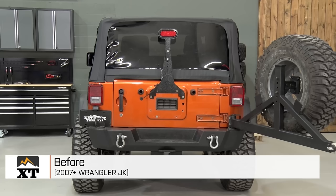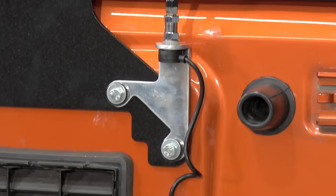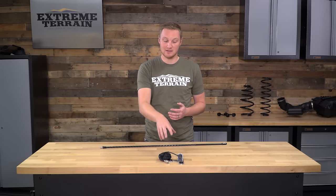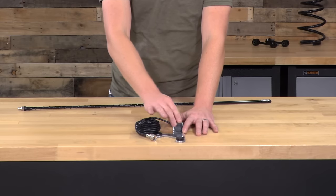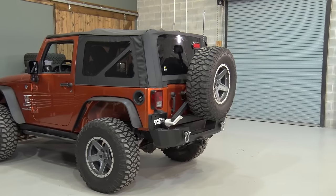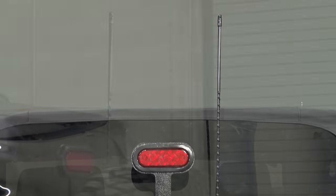So I wouldn't put too much weight behind the fact that this is exclusively tuned for a JK. As I said, this is all the parts you're going to need to get your CB working right out of the box, all in one place, which is a nice feature. You have an aluminum mount designed to go directly onto your spare tire mount. As long as you're still running a factory spare tire or have enough room between your tailgate and your tub-mounted or bumper-mounted spare tire carrier, you can run a setup like this. It also comes with the connector, the stud, and 18 feet of coax cable that will run directly up into your CB radio. The antenna is roughly three feet long, tunable, but a little more difficult to tune because you do have to do some cutting. The Jeep logo, of course, is at the tip of the antenna.